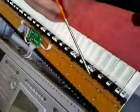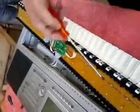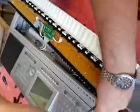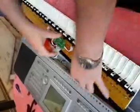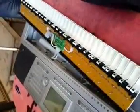Basically, if somebody's been living in a rural area and there's lots of dirt and dust, this dirt and dust is going to be in all the key contacts. So it's pointless trying to take each key out and clean them one at a time. What we have to do is loosen the circuit boards and loosen all these screws going right across to the other side. We're going to lift the circuit board out.